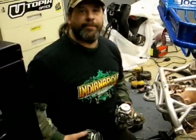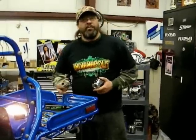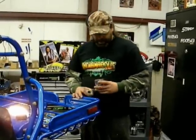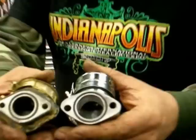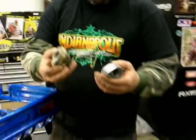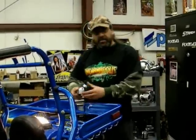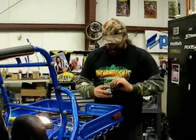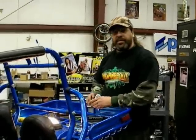You can go with a 30 or a 32 — in this case we're going with a 32 millimeter MRP Custom Carb. Now we're going to install the manifold for this 150 Hammerhead. The old and the new manifold have a big difference in intake size — we're definitely going to get a lot more fuel and air. It's also made out of metal instead of rubber, so it's not going to crack. The manifold gets mounted back on with two 10 millimeter bolts. Make sure your rubber seal is in there and it's good, then tighten them up and you're good to go.